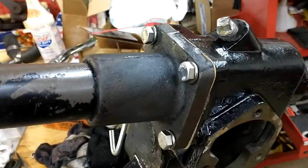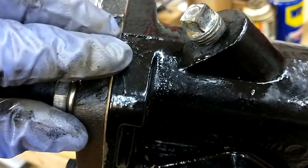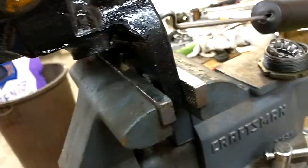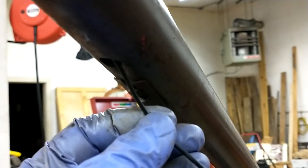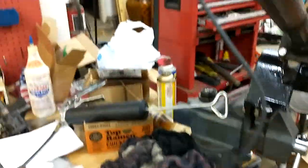I've got the steering mast back attached to the box with some nice new stainless steel bolts — didn't tighten it down all the way yet. I got my new gasket and put a little bit of grease on it to help hold it in place, because I did have to lift the shaft while holding the steering shaft in place since that's kind of loose and will just fall out. I got it clamped in a vice. Remember to make sure that the horn wire is on the bottom, because when this is hanging under the dash you want the horn wire on the bottom — make sure you don't snag the steering wheel shaft on the horn wire as it goes in, since this does get pushed back in once you're done.